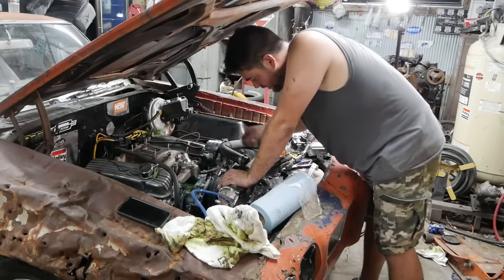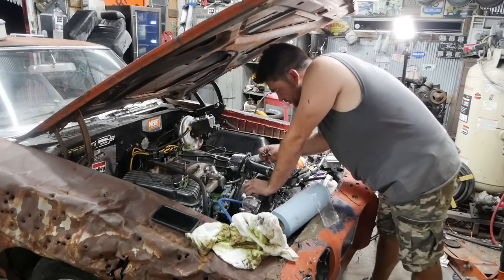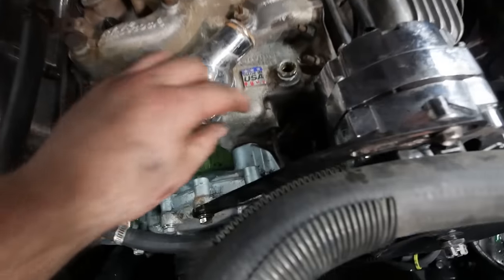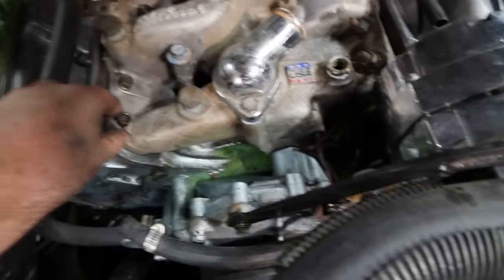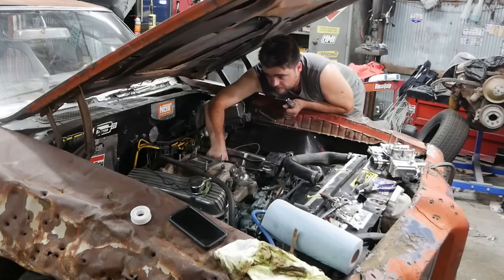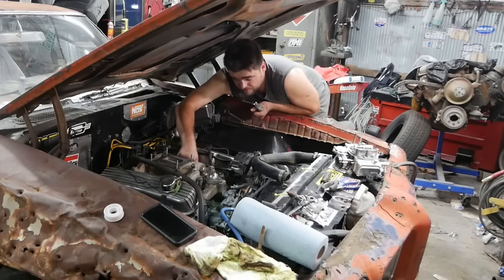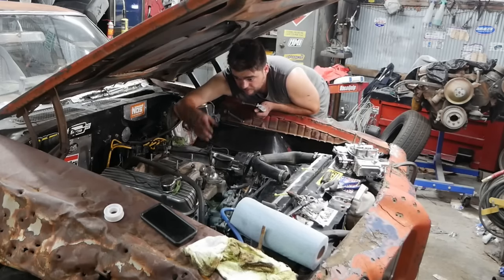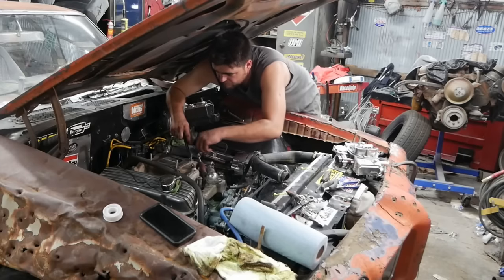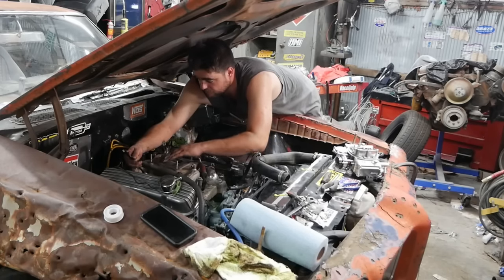On these it's really important to get all the bolts started kind of loose, barely not snug, then tighten up that front water pump bolt — it pulls the whole intake forward. Now with every bolt in kind of loose, tighten that down snug, then tighten them all up. Rule of thumb: any engine work where you have to torque something, you don't need to follow exact torque specs on an intake manifold, but you do need to do it in the right sequence — always start in the middle and work your way out in a crisscross pattern, like tightening a wheel. Then go over them one more time because they'll inevitably back off a little.